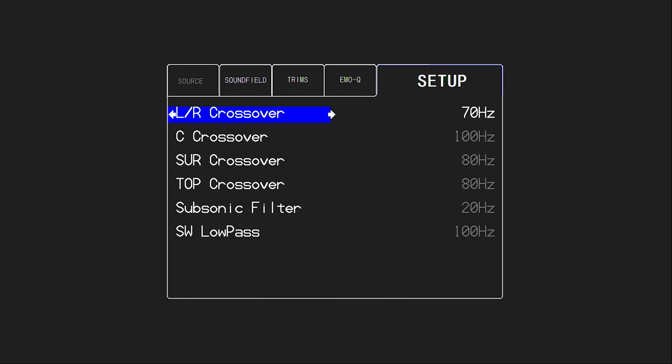In the Basics unit there is no small or large designation by name, but we can still designate it. If I set any crossover value here, the speaker will effectively act as small — so if I set my left/right to 60 Hz, anything under 60 Hz gets sent to my subwoofers. If I want to effectively set a speaker as large, I lower the crossover to the minimum of 35 Hz, and past that we have a bypass option which is effectively the same as setting that speaker to large — we're bypassing the crossover and sending a full range signal to the front left and right. Bypass is how you effectively set those to large.